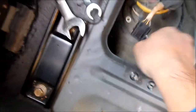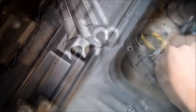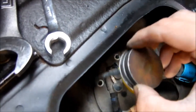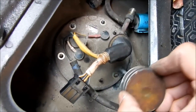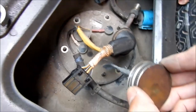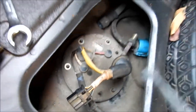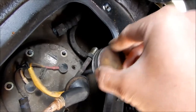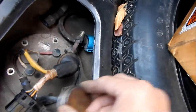It always wants to be a little difficult to get in there. Okay, let's make sure it's on there properly. I'll just put some anti-seize on these studs real quick — just the tip. My good friend here, anti-seize compound. Just dab a little bit on the tips there, just so if you ever need to get to the fuel pump again the studs won't be frozen. Fortunately this time they were not, so that's a good thing.